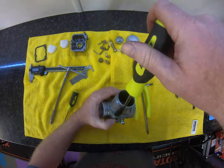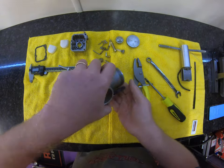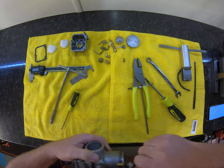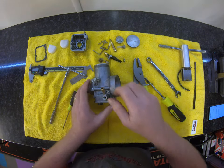Choke — just remove with a flathead screwdriver, pull it up, take the screw out, pull the choke straight out. So you've got two parts left.